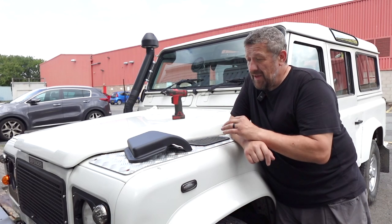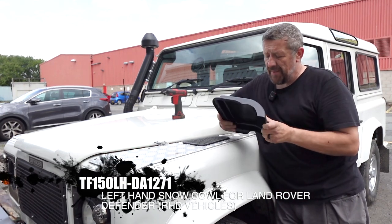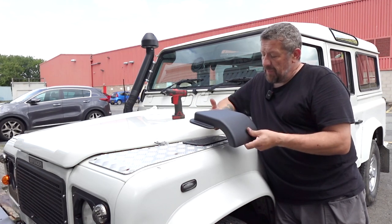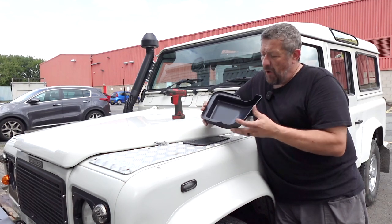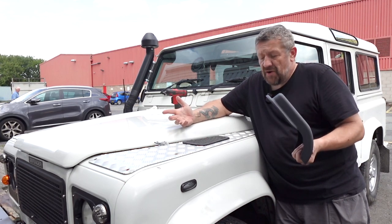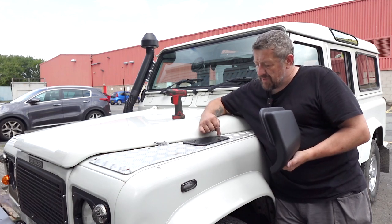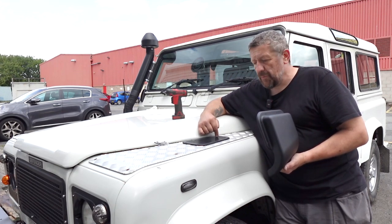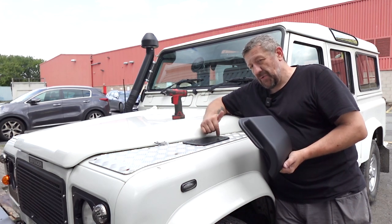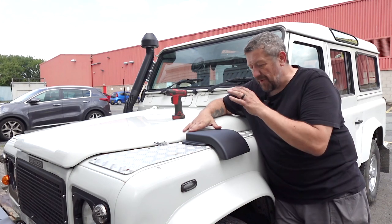The last thing we're going to fit today with a screwdriver is a snow cowl. You've probably seen these on many vehicles — they originated from the military where they were made out of metal, but over the years they've been copied and fabricated out of plastic. It's a great product because it prevents snow packing into your air intake, but also because a lot of these air intakes are quite old, the drain bung inside is often blocked, which means if it rains heavily the water won't drain out and will actually run into your heater air box and start corrosion. So these aren't just great for snow — they're also fantastic for rain.